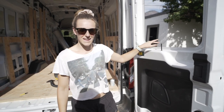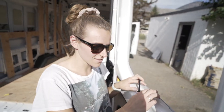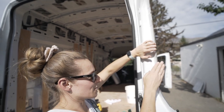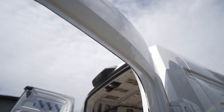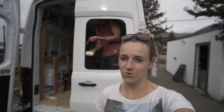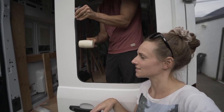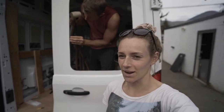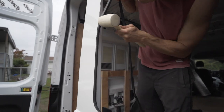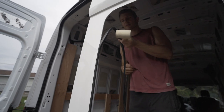If you followed the steps until now, you'll notice that on the inside between the two sheets of metal there's a little bit of foam around each edge. At the bottom it's quite easy to scoop out, the outer side as well, but on the inner bit and the top it's really narrow. We're hoping the trim will kind of pound it in, but I've slid a utility knife in to try to break it up a little. Tim's putting the window trim on and it's fitting in nicely, pushing that insulation or glue backwards pretty well. You just have to hit it pretty hard to persuade it in — the outer corners and bottom were no problem.